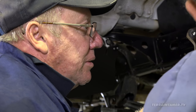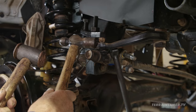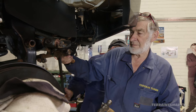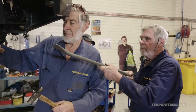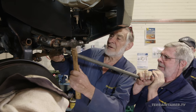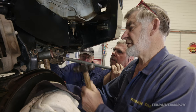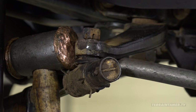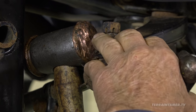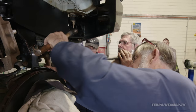You get like that sometimes. Need a bigger hammer. I've got good leverage under there. I'll hit that instead of the other one. Put the bigger one in, mate. Does size actually matter? So we've got a problem with these tie rod ends — they're tapered. They probably haven't been out since brand new. They're corroded or jammed or rusted and they get terribly tight. The only way to do it is to distort the taper and they spring out. There we go.